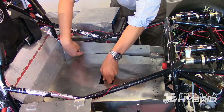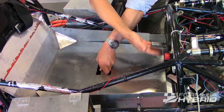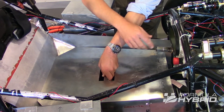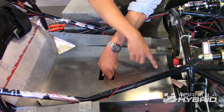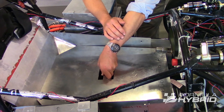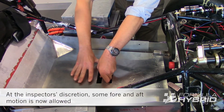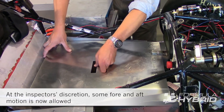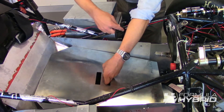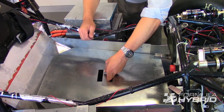You can see that this template does touch portions of the firewall, and that's okay. However, this template, if lifted, would hit the steering column. The way the rule is written, the steering column — if removed — must allow clearance, and in this case it would. As a practical matter, we don't ask teams to remove the steering column during tech inspection, so we'll either bring the template in from above and down below the side impact member, or start at the bottom and bring it up. Things that get teams in trouble is when they design exactly to the template and then allow zip ties, wires, or vehicle controls to get in the way. We ask that you design a little bit wider than the template to give yourself extra room.